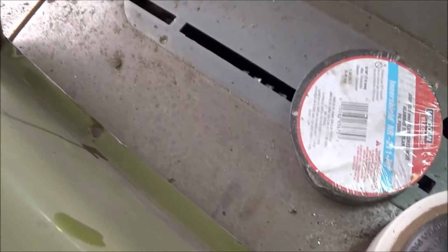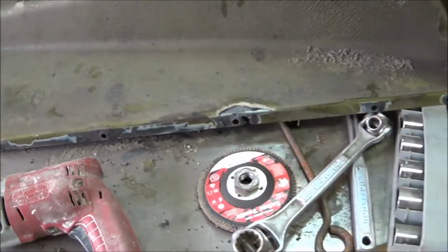Oh, I still have to do these. Yeah, it's not done. But I've been starting the interior as well. I've done some of it. I've applied Fast Etch to that as well. So you can see where it rusted through in a lot of spots. And I still have to grind out some more and create my patch panels. So hopefully by the end of today I'll have this completed and all welded in and done. I'd really like to get at least this one panel finished.